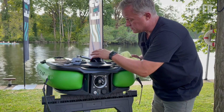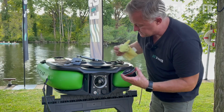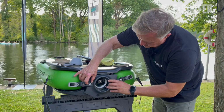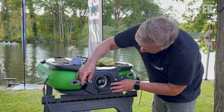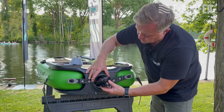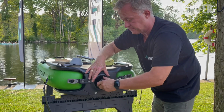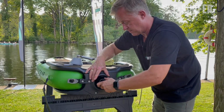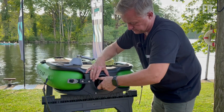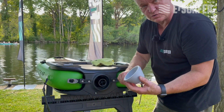Last but not least, we have to assemble everything again. Again, make sure everything is clean inside and here at the nozzle. Then you take the rear cover, put it on its place, and screw in the nozzle counterclockwise, at first by hand. Like this. Then you take the torque wrench again with the tool for the nozzle.